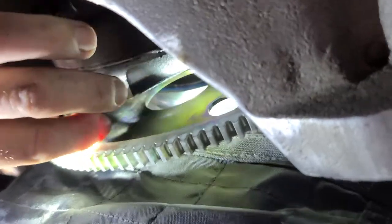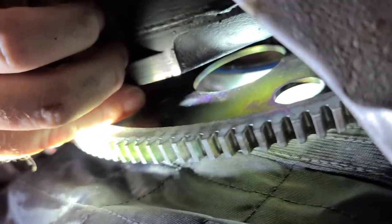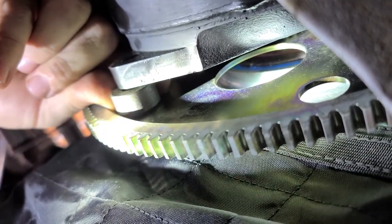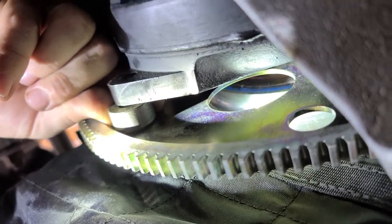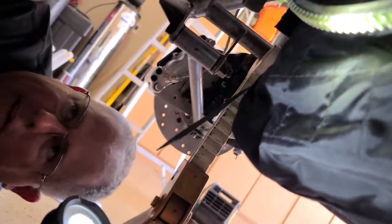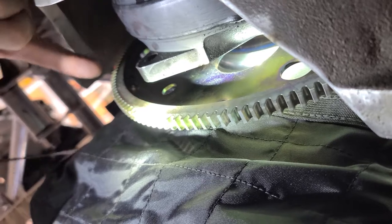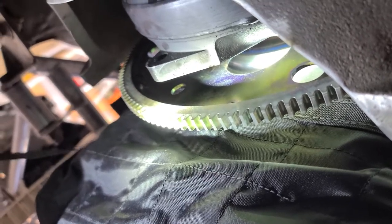This was measured out prior to this — these are half-inch shims. These shims go right between the flex plate and the converter. To figure out how much shim you need, you can use washers, you can use metal shims — it really doesn't matter, as long as they're all the same material and basically the same weight. Some converters only need one washer, some need a whole bunch, some need a half-inch of spacer. It all depends on who made the bell housing, who made the block, who made the converter, and how it all bolts together.